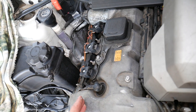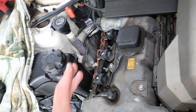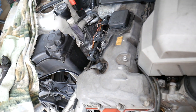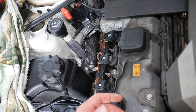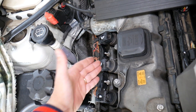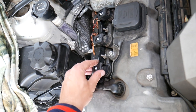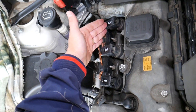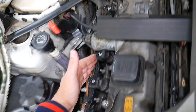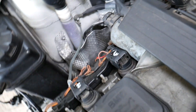If the scan says a code for ignition coil cylinder number three, you'll get code P0353, or it will state something like 'ignition coil C' — C meaning it's the third ignition coil (A, B, C). The last digit of the code corresponds to the cylinder number: 353 corresponds to cylinder three, and code P0355 would correspond to cylinder five.